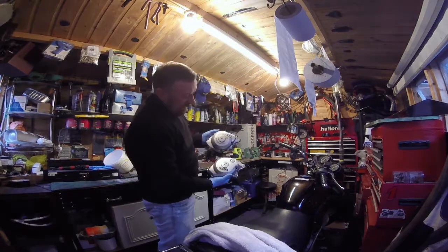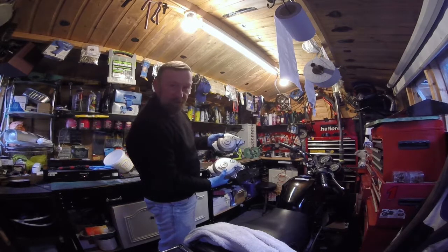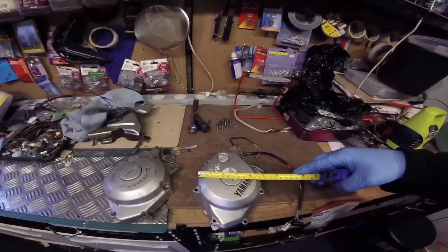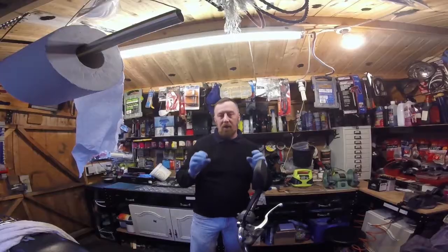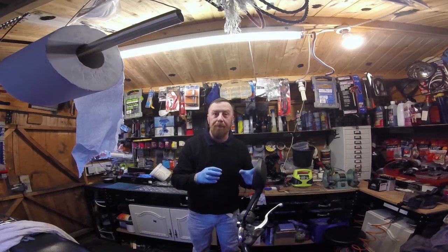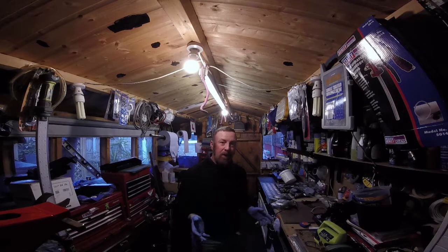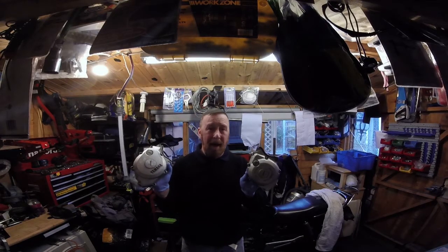Started scratching my head. I noticed it at the start of this video — the answer's on the cover: 'Yamaha four stroke.' So I measured these: 13mm, then 14mm. The cover's smaller, the stator's smaller, and the bell housing's smaller. I need a Mark 1. The problem is all of the ones for sale are the larger ones and I've got no idea how to get a smaller one.